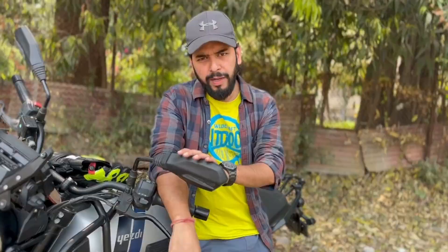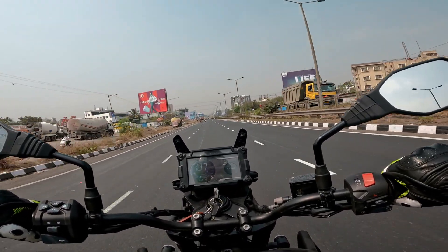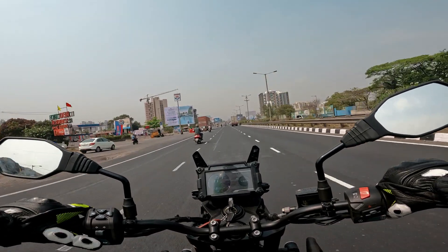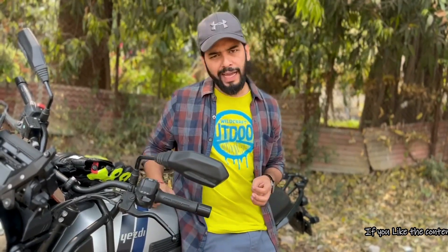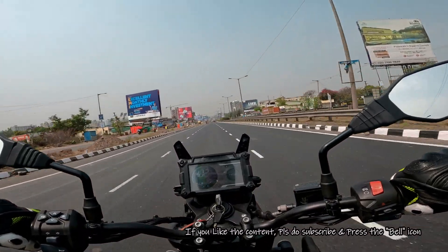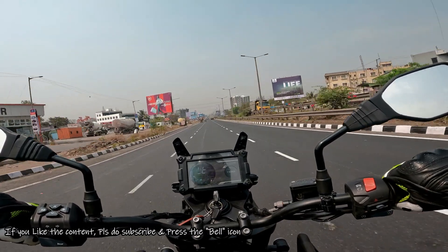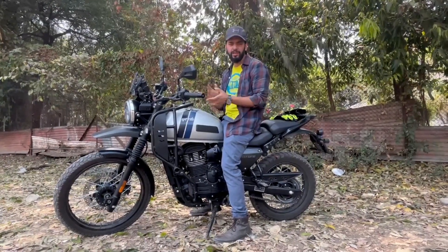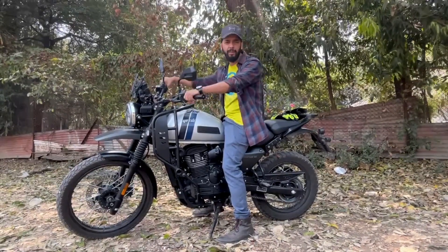When we talk about highway riding, comfortable cruise speed and engine vibration are important aspects. In city and off-road, these aren't critical, but on the highway they matter. If you are driving this bike in 6th gear at 90 to 110 km/h, that is a comfortable cruise speed with no vibrations, as your RPM stays at 5,000 to 6,000. But if you go to 5th gear at 110 to 120 km/h, that means you go beyond 6,000 RPM and there will be vibrations in the foot pegs and tank. The sweetest range to ride this bike is 4,000 to 6,000 RPM. Highway riding ride comfort is the most important thing.